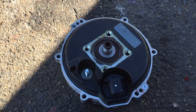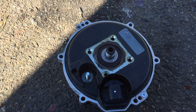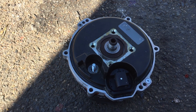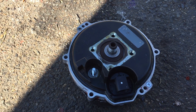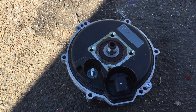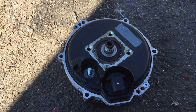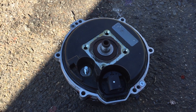One thing to be careful of: make sure you get all the air bled out of the water lines. If not, the first time you drive it it'll overheat. Simply reverse the process putting it back in. When you get done, use a voltage meter to check it — you should have about 14 volts coming out of it. If your battery light goes out, then you probably got it. Subscribe and check some of my other videos; I've got more videos on BMW repairs and other things. Hope you have a nice day.